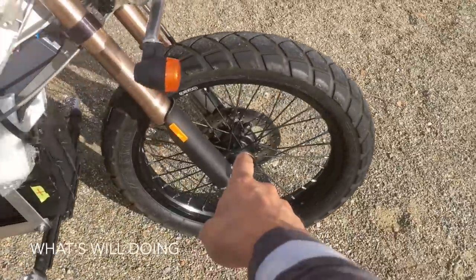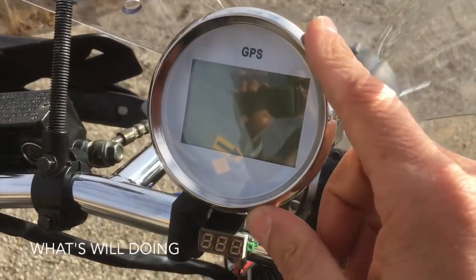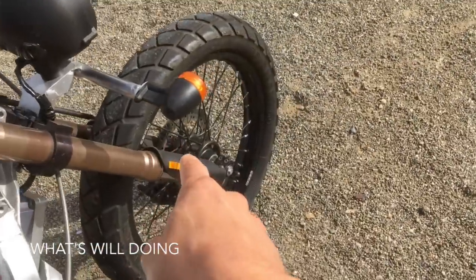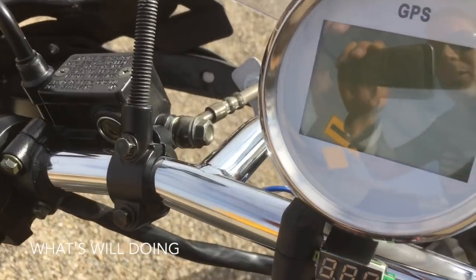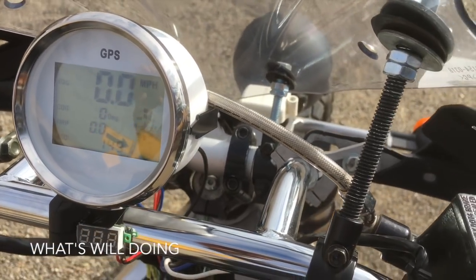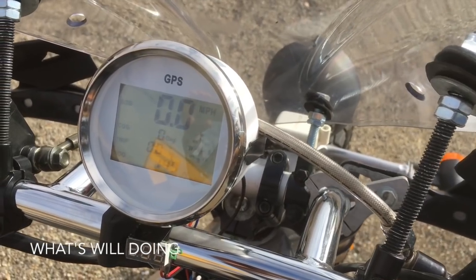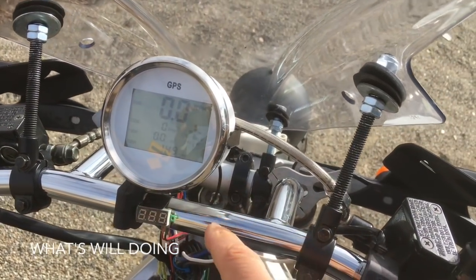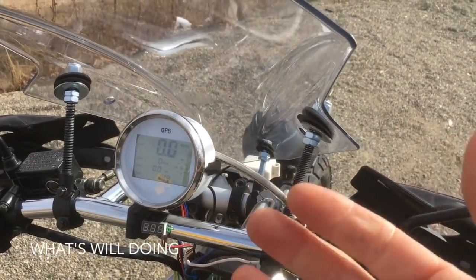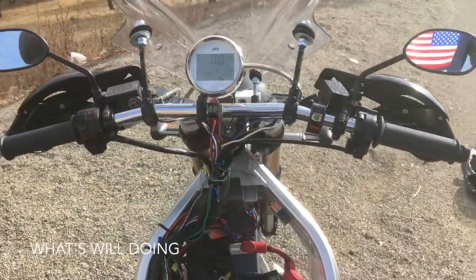I didn't have a speedo pickup down here, so what I did was go to Banggood and I found a GPS speedo. I thought hey, that's pretty cool — I don't have to do any sort of mechanical stuff down at the front wheel. This GPS speedo here — it's working pretty good. I think it's like 60 or 80 bucks on Banggood. My testing shows that it's about 5 to 6% off — you really just have to add about one and a half miles per hour to get your actual speed. Also when you're accelerating, it seems to be trying to calculate the acceleration and so it doesn't seem to be really matching what's going on in the real world.